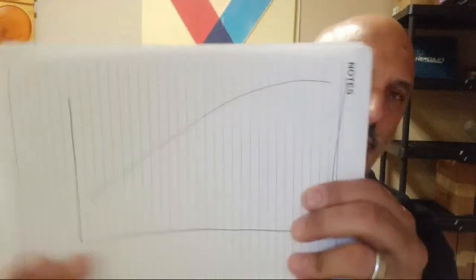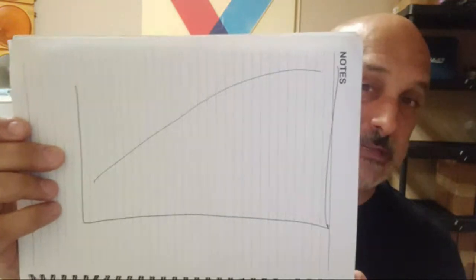is that you'd have this torque curve. You'd have a torque curve that would start out, or a horsepower curve. Let's talk about horsepower. It's easier for you guys to visualize that. That would start out, and it would look basically just like this. That would be your stock horsepower curve for any of these cars, 392s especially. And they would carry power pretty well out. You get a little bit of overrun, but the idea is that you don't really have to shift them that high. And what would happen with these aftermarket cams is that the power curve would do this.